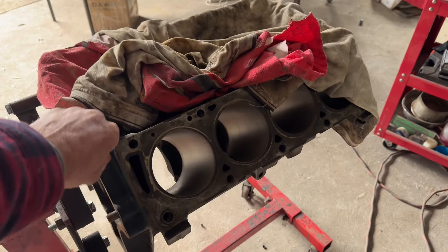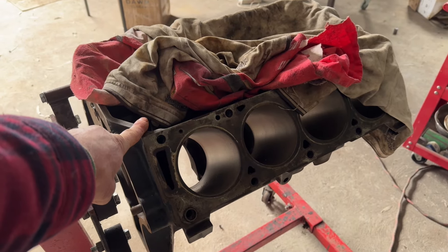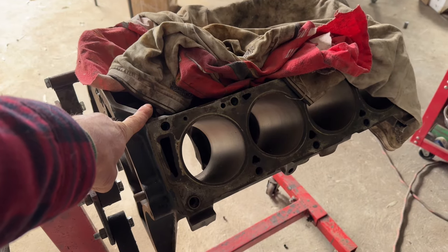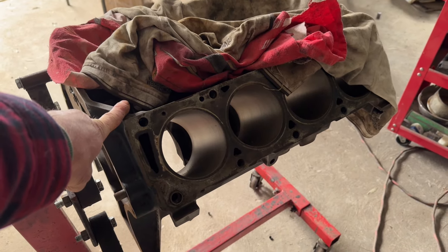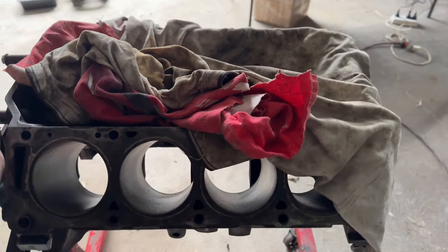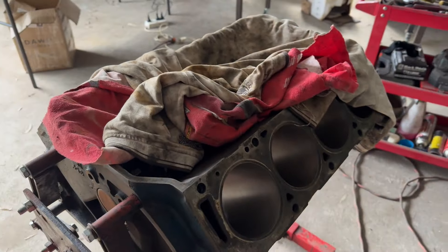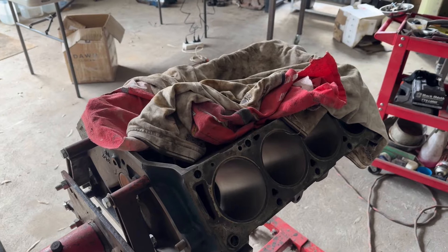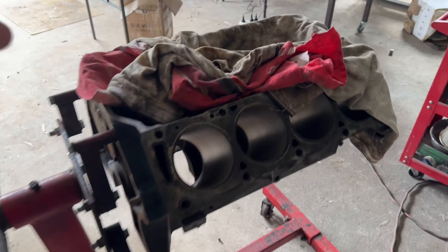This is the 352 — I believe it's the original engine out of the truck. It's all matching, sort of '67 numbers, which is pretty good. Went through it, did some measurements, everything seems okay. I'm going to use the original pistons with new bearings and new rings. The crank needed a bit of a polish so I got it ground. All in all, I'm just keeping it stock — two-barrel, easy and quick, on the cheaper side versus going full cam, pistons, stroker and all that.